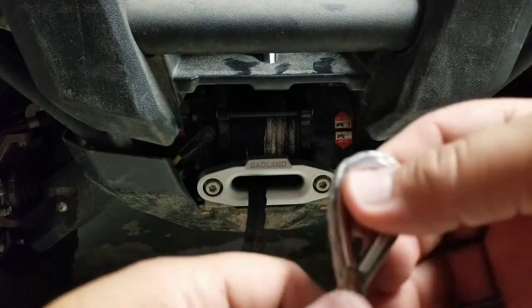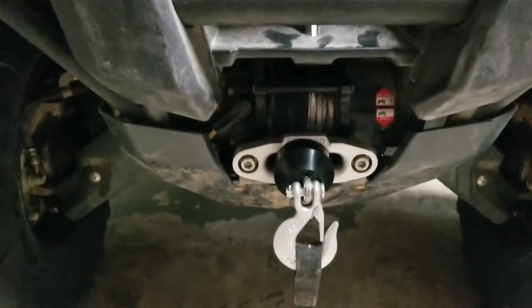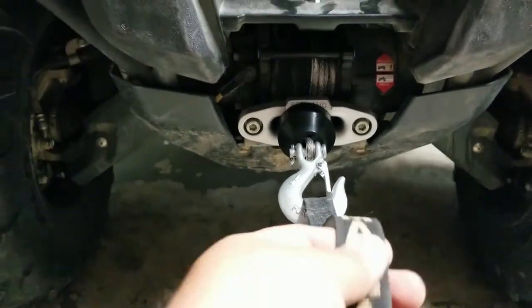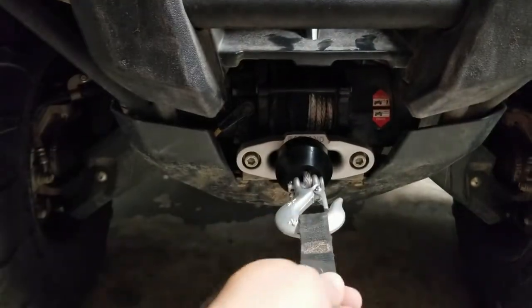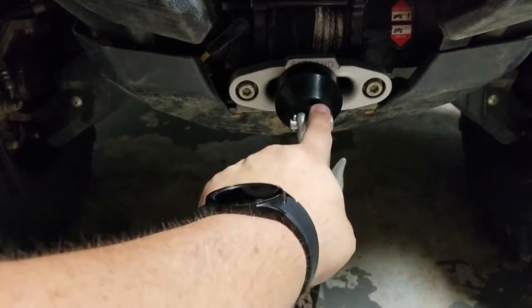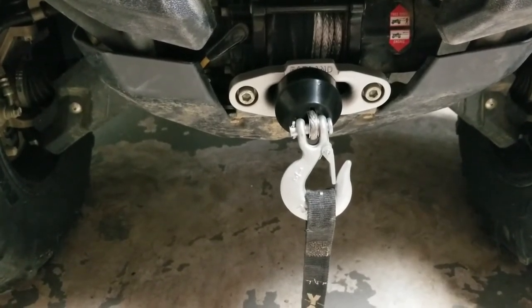Now that it's on, we can go ahead and get our hook back on there. Once you've snugged it up to your machine to the fair lead, you can put it in the center — it's off to one side, however you want. On mine it has this safety strap with the brand on it, just so you're not pulling on the hook, since it came with the cable — so you're not cutting yourself with a frayed cable end or something. That's all I wanted to share — how to install a winch saver onto a winch rope. Thanks for watching, I hope you enjoyed it and got something out of this video. Please feel free to leave a comment, like and subscribe — I'll see you on the next one.